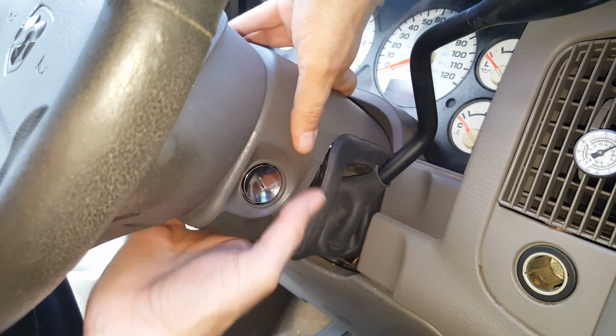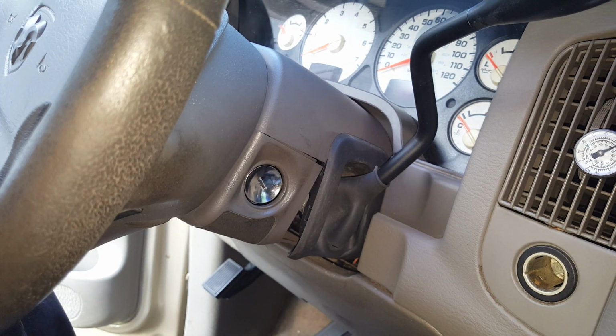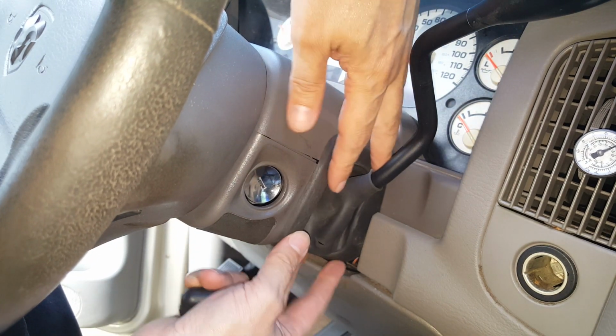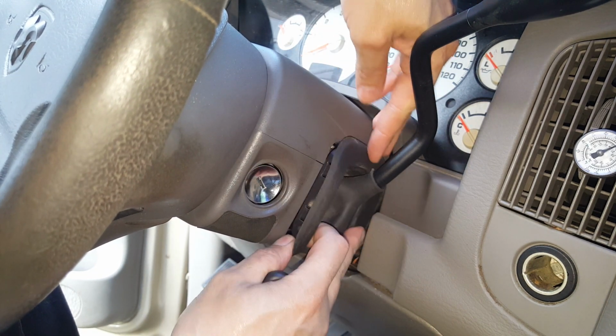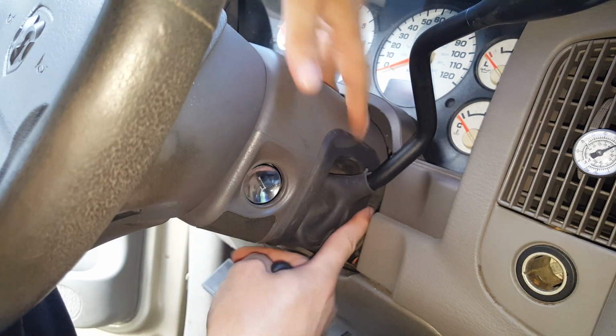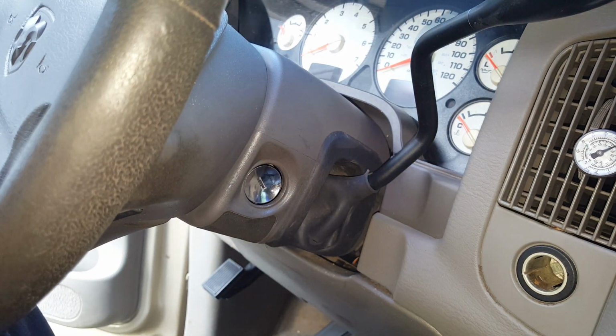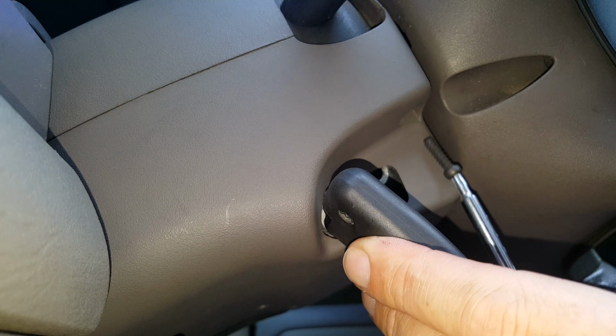And you have to slide it over that tilt lever before you can pop it over your ignition part here. And I'm going to go ahead and pop this in place because it'll be easier now than waiting till I get it screwed together. But just want to make sure that that's back in place. And we'll go ahead and put this little tilt lever back on. Okay, so I'm just getting my Torx back into place here. And I already got the little machine screw in. Just getting the one over here by the tilt lever. And I probably should have waited before putting that on.